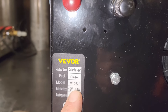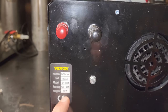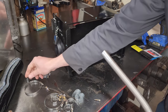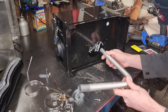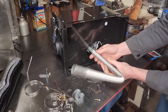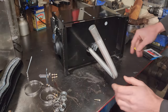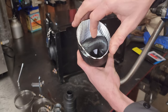Car parking heater diesel model WF5001, 12 volts at 40 watts, 8 kilowatt heat output. Now for hooking the exhaust up, you can just flex this out however you like. This is a good grade of stainless steel. You got these two ports down here - I assume this is the exhaust side because it's the only side this one fits on, and the other must be the inlet. Look at that, slips right on. You get some hose clamps and brackets depending on how you want to arrange that.